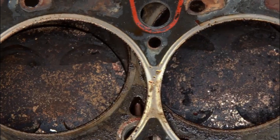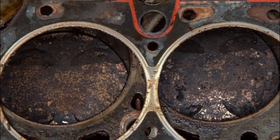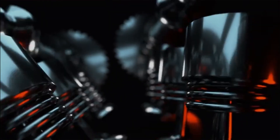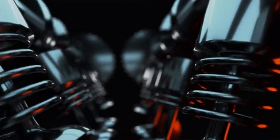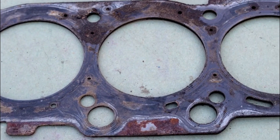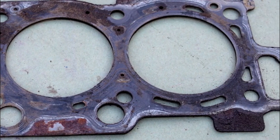The good news is there's a workaround for this issue to give K-Seal Ultimate the best chance of repairing the leak. With overpressurizing, combustion gases from the cylinders are leaking into the cooling system through the same failure point that K-Seal Ultimate is trying to repair.